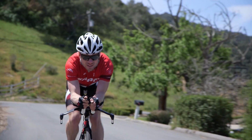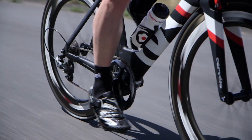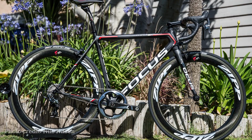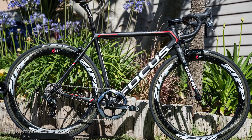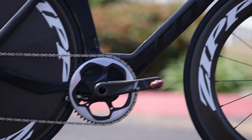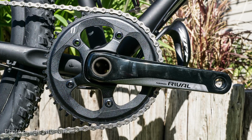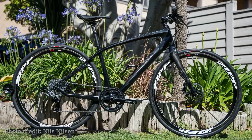And because there's less parts in the drivetrain, I should imagine people would think that you're going to make some sort of weight saving. So, will it be a groupset that's going to end up with all your weight weenies spec'ing? Overall, it's not aimed at purely saving weight, because a comparison of SRAM's Force 22 groupset compared to the Force 1 groupset, you save around about 50 grams overall for the groupset weight. So it's not about the weight saving, but the key part is, because you're not paying for a front mech, and the shifter mechanism in the left lever, there is quite a large cost saving to be had. So for, say, the commuting market, fitness market, there's a definite bonus there.